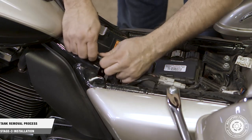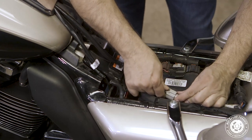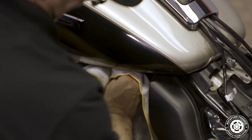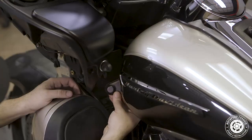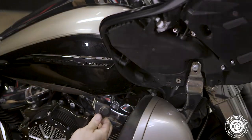Now we're ready to remove the gas tank. We'll start off by disconnecting the electrical harnesses and pulling the breather lines in back. Next we'll disconnect the gas line — push up on the hose while sliding the fitting upward and pull down on the gas line. Once that's done, we'll detach two rubber boots from both sides of the front of the gas tank and use a half inch socket to remove those bolts. Then we'll go to the back and remove two more bolts from the gas tank using the same socket.